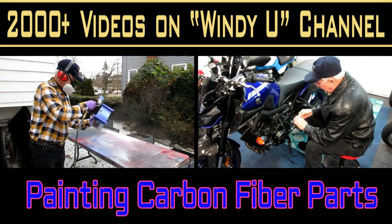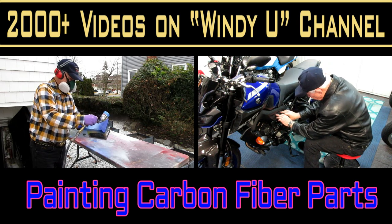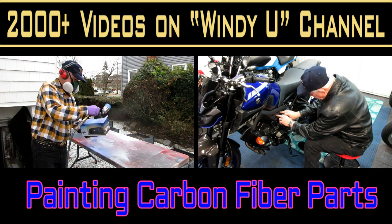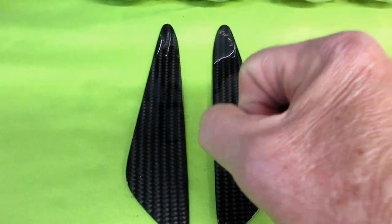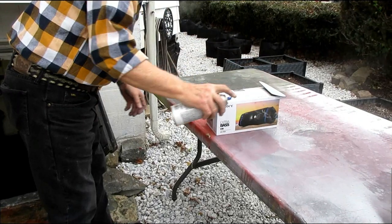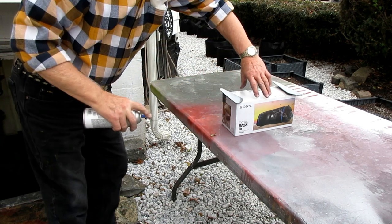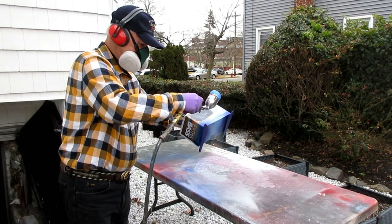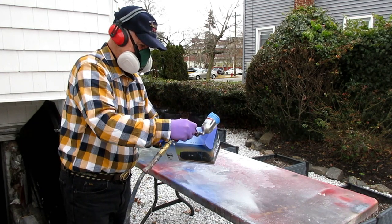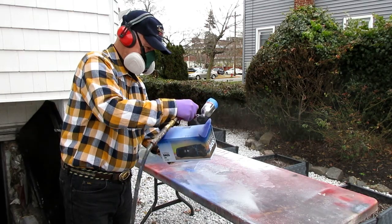Today I started with some raw carbon fiber parts that we had made on a previous video. I showed the proper prep for getting the primer to stick, compared the primer method to the weave ones we just finished, and went over the difference in finishing each type. I got the priming done and because we had a very cold day, putting parts up by the heating vent accelerated it to the point where we got them painted blue. By the end of the day we even got the clear on and got the parts in the garage drying, all in one day.